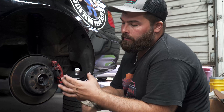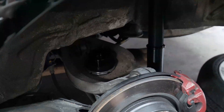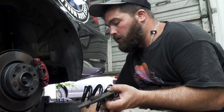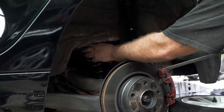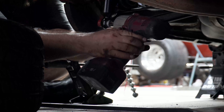You're going to need a 12mm Allen wrench so that you can attach the spring perch, and the spring is going to set right there. Before you stick the bolts in, make sure you put some anti-seize on there. The directions didn't say to reuse the top pad, but we're going to reuse it because it will likely squeak otherwise. Then reinstall the bolt.